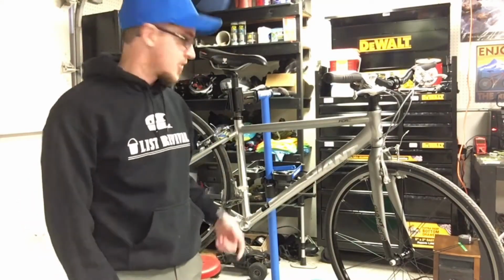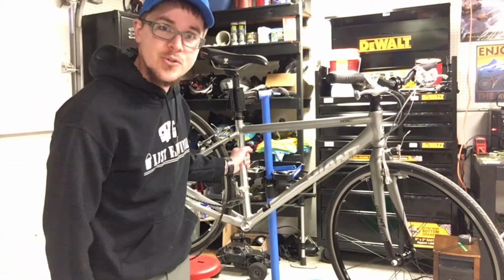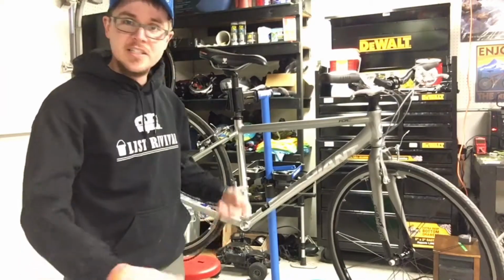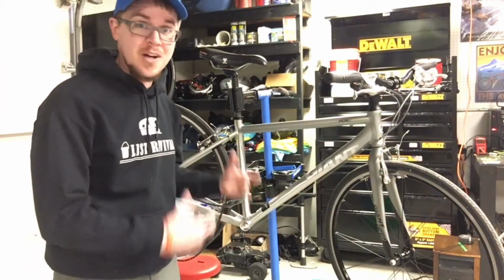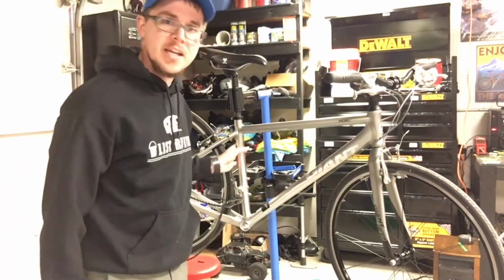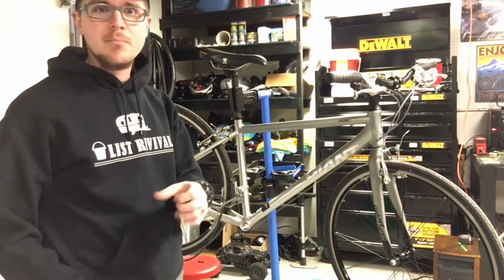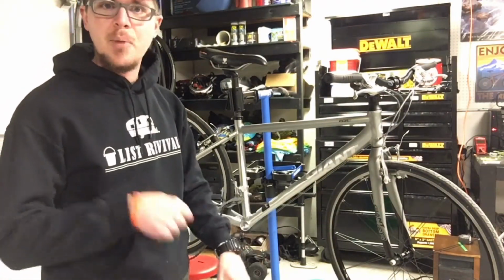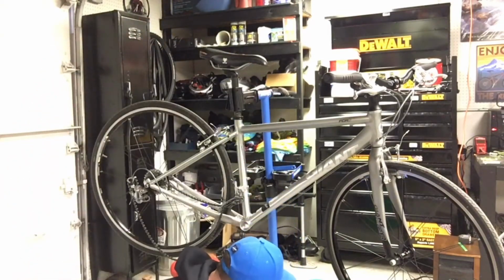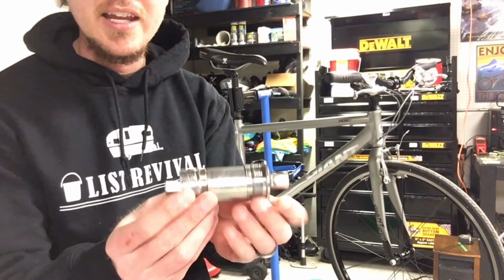In today's video, I'm actually going to replace the bottom bracket in this Giant FCR2. I'm getting ready to sell this bike. I buy, fix, and sell bikes as a side business hobby, so I do a lot of these. But I already tore out the bottom bracket in this bike, because as I was taking it on a test drive, I could hear that bottom bracket creaking and then popping occasionally, and so those bearings had actually gone bad. So this is actually the old bottom bracket.